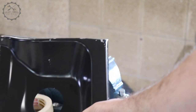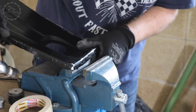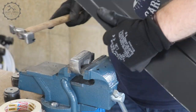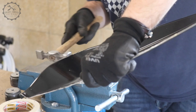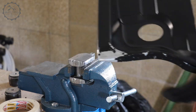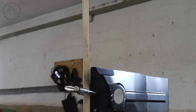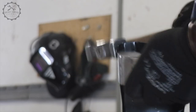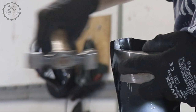Third, and most importantly, I don't like replacing stuff if I can just as well save it. In my car, the front edge of the floor pan section is straight, but the front end of the repair panel has a curved edge, so I had to beat the fold straight first and then beat it in again in a different place. Regarding spare part paint: some parts come with gray paint that isn't durable and needs to go off; some come with flat black paint which seems similar. However, some parts come with glossy black paint that is a good component paint and quite robust, so this time I kept it on the parts.